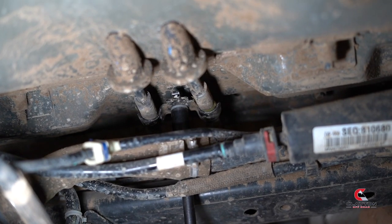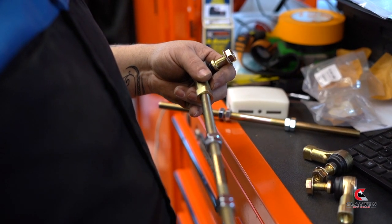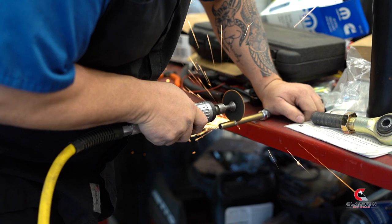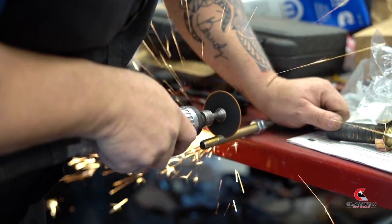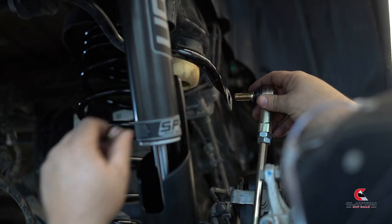Reattach the emergency brake cable bracket. Refer to the Clayton website for recommended lengths of your sway bar linkage. When the tires are on the vehicle and it is sitting on the ground, you want the sway bars to be sitting just north of horizontal. Attach your sway bar linkage and tighten the jam nuts.